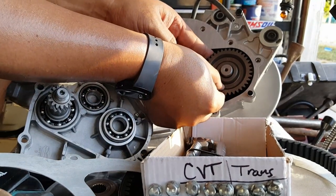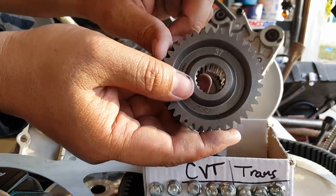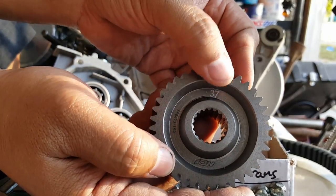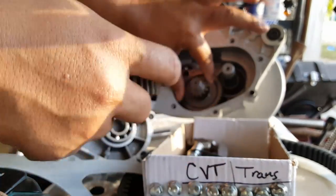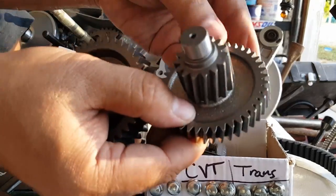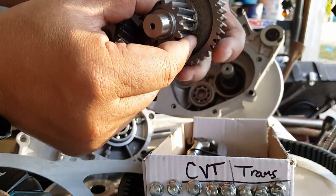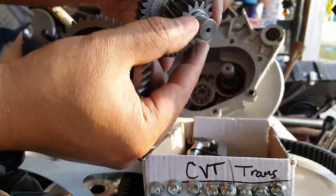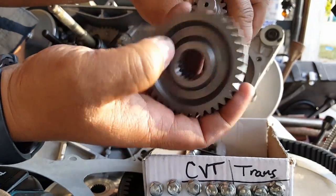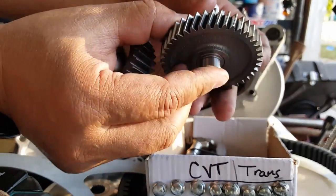When you get a gear set, it usually comes with this piece — this is a gear set. This is an NCY one, which we already upgraded, but I want to show you how we put it in. It's an NCY, number 37 by 15, so that means this is a 15-tooth gear. You'll need almost a 12-ton press to actually get the OEM one off. You're going to reuse this whole gear, but not the shaft with the teeth. The shaft and this piece usually come sold together as a set. For the OEM, you'll need about a 12-ton compression press to get it off and put the new one back on.